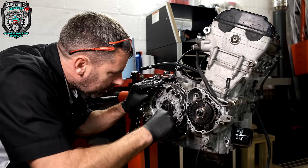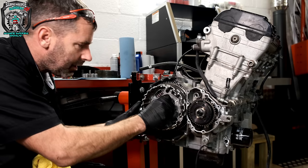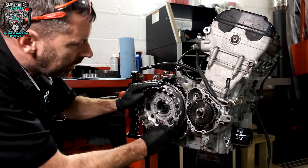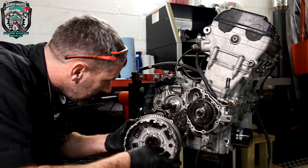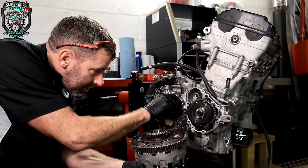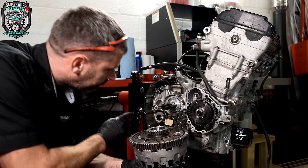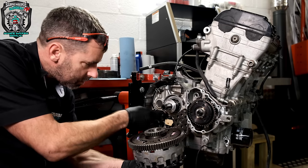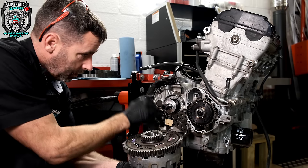There's a little spacer here and a needle roller bearing — that's fine. You've got to get the spacer and the bearing out, then the clutch basket has enough room to drop down and you can slide it out. There's a gear position sensor pick-up there — three wires — which is why the clutch did have to come off.